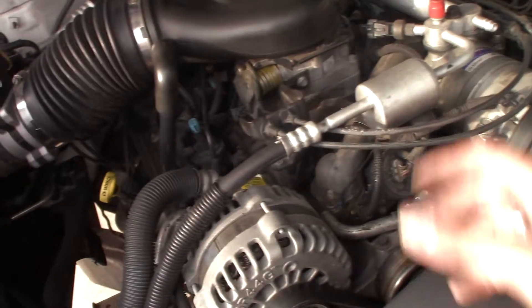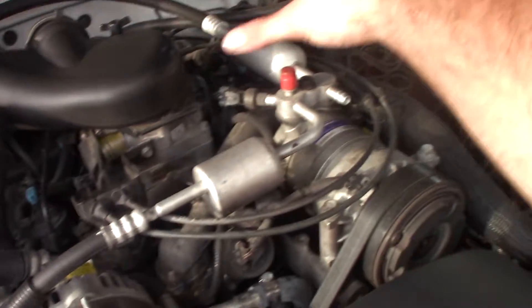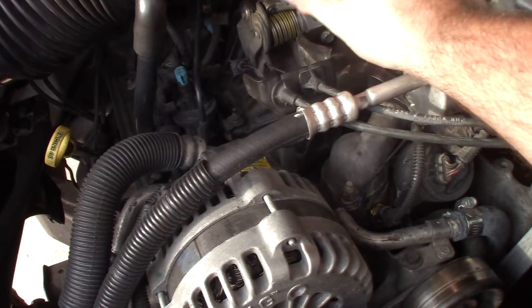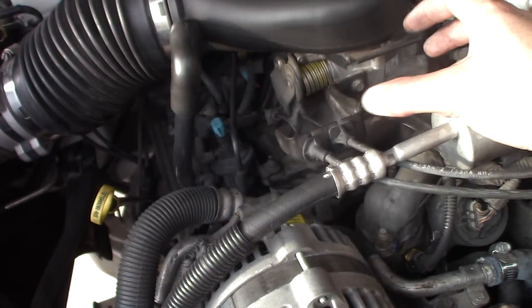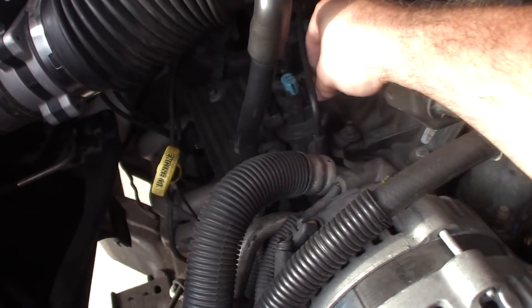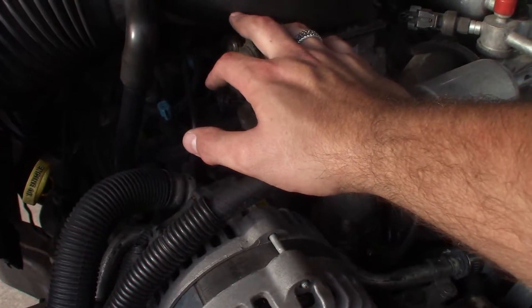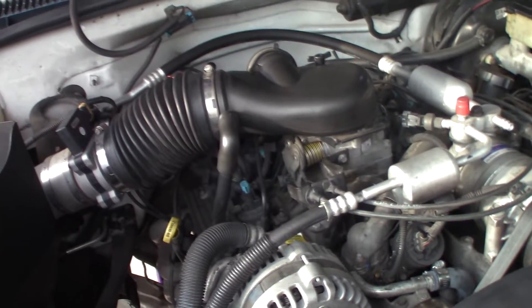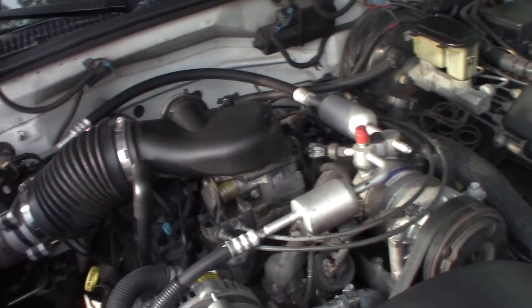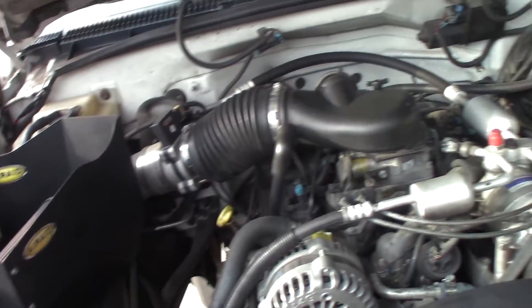I was really thinking it probably still is the fuel injectors. Fuel injectors in these trucks are definitely known for cracking and adding excess fuel to the system. In order to get to the injectors, you've got to pull off everything up here — all your AC components, your throttle body, the coil, all that stuff, pull the upper intake manifold, and get to the spider injection system from there. That's something I didn't really want to mess with until I built a new engine. I'm not quite sure this sensor is going to fix my problem.